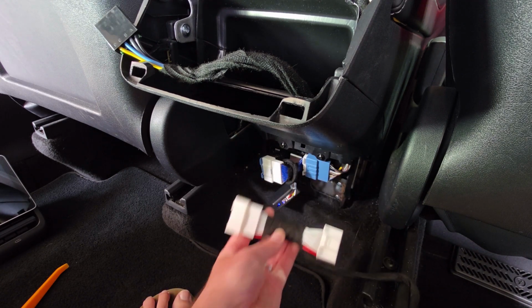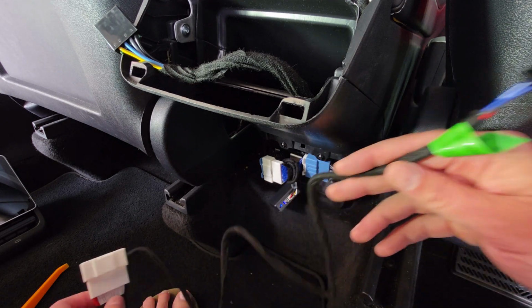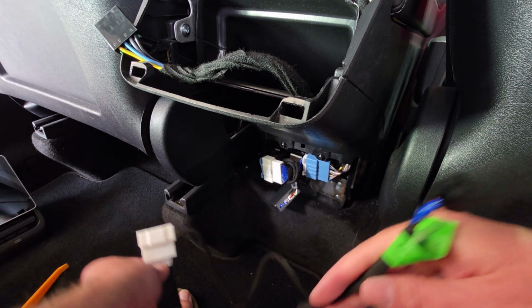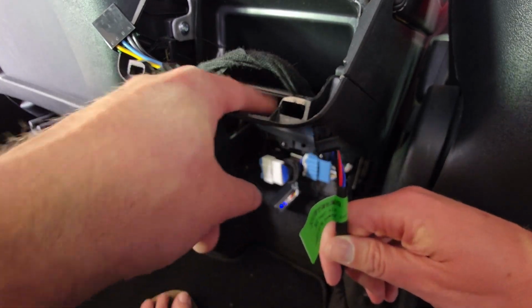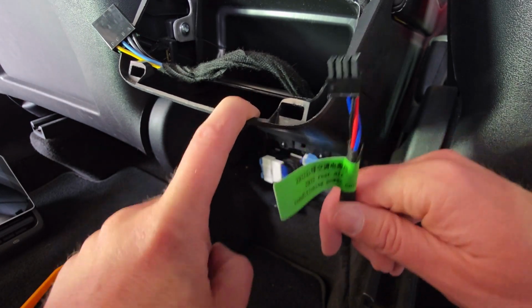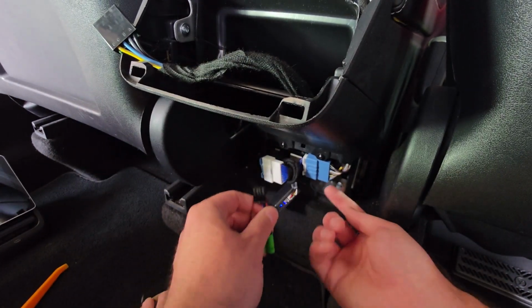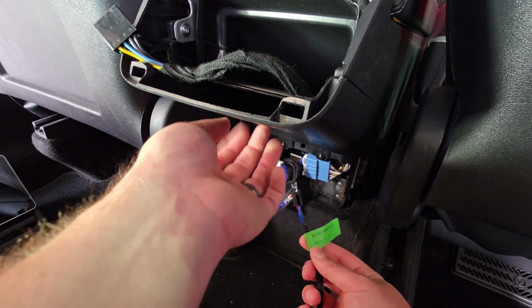This is going to be our jumper cable. It's going to go right here in just a little bit, but I actually unwrapped the rest of the cable that comes with it. I don't know, it's maybe 2 feet long. What we need to do with this end is get it up to this part where it's going to plug into our actual screen. You can take off this cover if you want, but I find it easier just to go up and underneath right through here, just running up along this plastic channel.